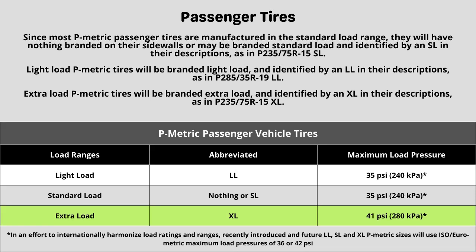Each designation represents a different term when looking at a tire. This can directly affect things like max tire pressure and also plays a part in the next two numbers we are going to talk about. When in doubt of the rating your vehicle requires, in most cases it is safe to go with the same rating your vehicle currently has, as long as it was replaced with the correct spec of tire last time they were replaced. Now let's talk about the other two components, load index and speed rating.